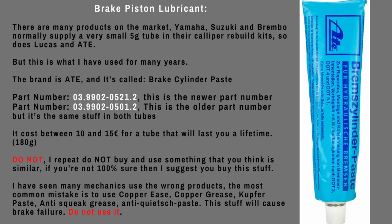The third thing — look at the picture above, press pause and read the information. This is really important. The lubricant you choose to free off those pistons is utterly, totally vital — you must use the right stuff. I've put some part numbers up on the image so you can buy these; Amazon even has them, both old and new type, same stuff in both tubes. Don't think you can choose a different product from a different manufacturer — the lubricant must not have a detrimental effect on the seals at the back of the pistons.